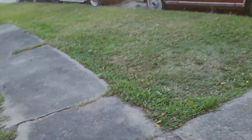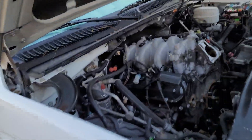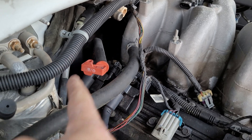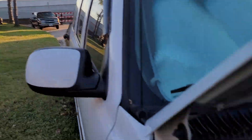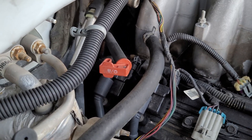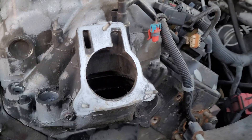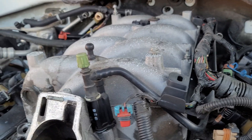Getting it apart was actually quite easy. I was really impressed with the way GM assembled these GM T800s. Even for the big blocks with such a massive size engine, a lot of things were easy to get to. I will admit the bell housing bolts were not easy — on the dually over there in the corner I had a two-inch body lift and enough room to get in, but on this one I did not have much room, so it was really tight to get my hands and extensions up in there. The motor was actually really clean when they dropped the rod — really depressing to see that they'd done that to it.